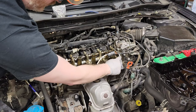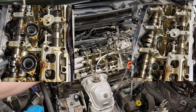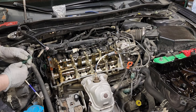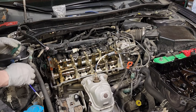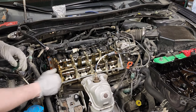Keep in mind that you've got to get all these surfaces perfectly clean — remove all the grime, remove any material that's left on it. Once it's fully clean, then you can go through and clean the valve cover itself. Then once that's clean, we can begin reassembly. There are one, two, three, four, five, six locations where we have to clean, remove a bit of factory RTV, and then put new RTV.